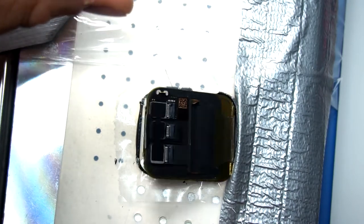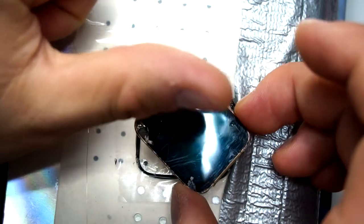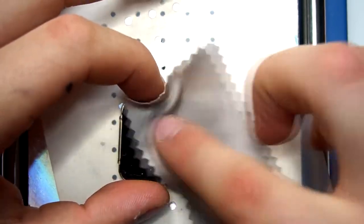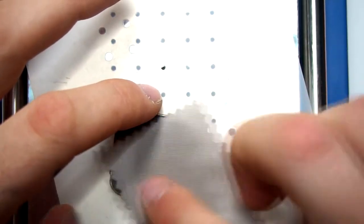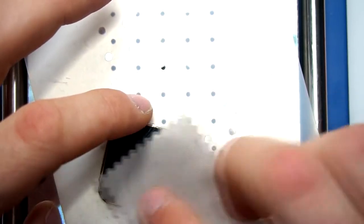When you have removed the glass from the OLED, our next step is to clean the rest of the glue. Therefore, you can use your fingers, and for the little pieces, you use this liquid I showed in the video. I will link the liquid in the description so you can buy it for removing the OCA glue. After you have cleaned all of that, you have a few scratches, that's no problem because the LOCA will fill them.